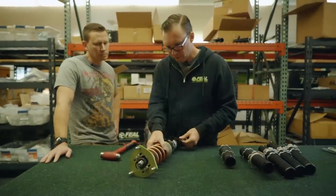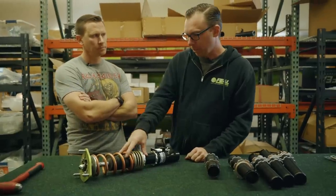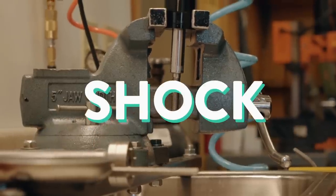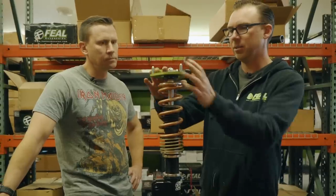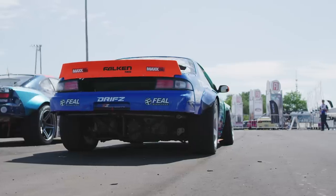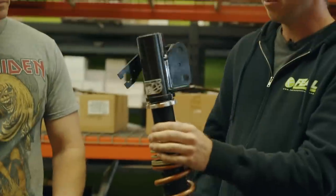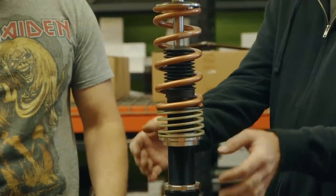This is a coilover from a Nissan 240SX. It's a McPherson style shock — a coilover with spring preload adjustability, meaning these locking collars can preload the spring more or less. This whole coilover system is the upper control arm and the shock. It's got to be structurally sound to take side loads, not buckle or bend, and has to have a good solid top mount. What's cool about most coilovers is that you can adjust spring preload, which changes the ride height, how much suspension droop you have, how much compression travel you have. And if the coilover kit has this feature, you can adjust ride height by simply turning the lower mount in or out — making the shock longer or shorter. Not all coilovers are designed like that; on a lot of them the lower mount is permanently fixed to the shock body.